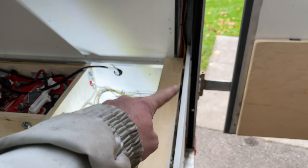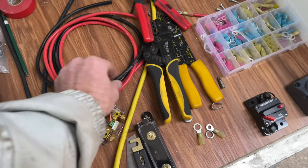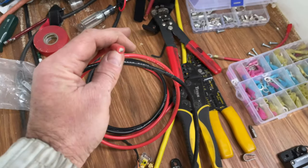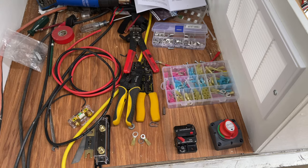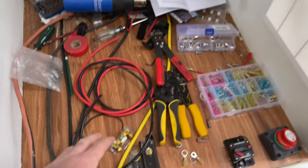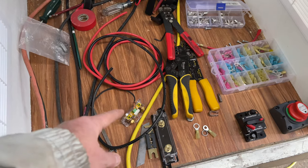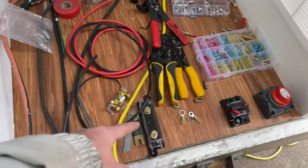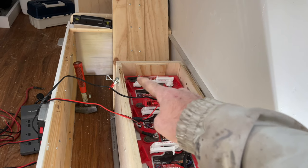There's going to be a switch on that wire. I'm running all the wiring with number eight gauge multi-strand wire, using yellow crimp connectors — the liquid tights. I want to run everything through a shunt because I want to be able to measure my amps. I've got a 50 amp fuse. I'm not running an inverter so 50 amps is more than enough. I'm going to mount that 50 amp fuse right in there, close to the battery terminal where I'm bringing off all the power.